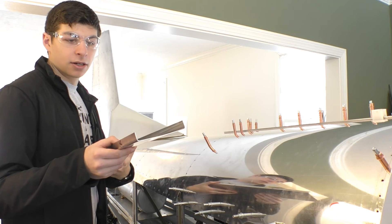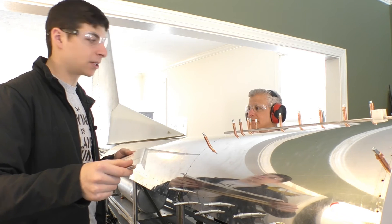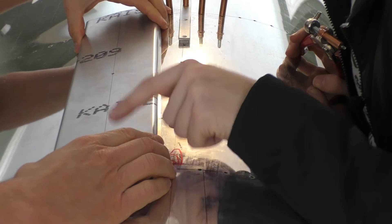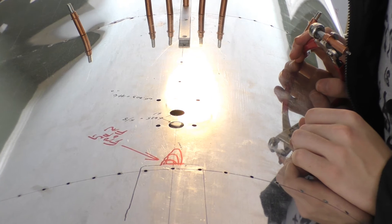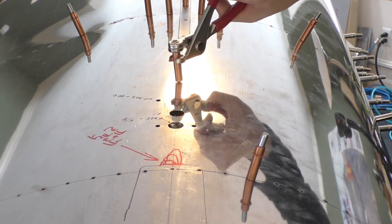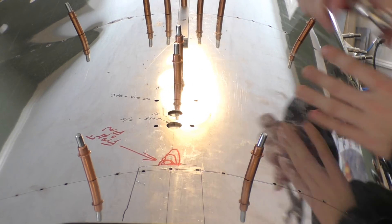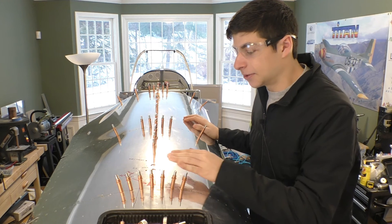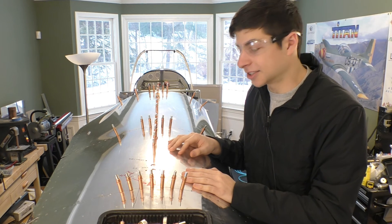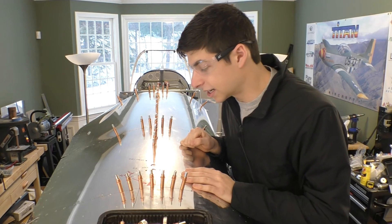We made this doubler out of 0.032 aluminum. It's going on the bottom side with a centerline of rivets, and it will be attached using the same glue used on the side skin. I learned a lesson here: I was able to properly place the holes in the turtledeck for the antenna, but when we put the doubler on, the holes weren't aligned. I'll have to match the larger holes into the doubler as best I can to get everything to line up.